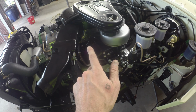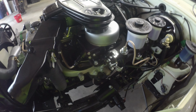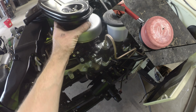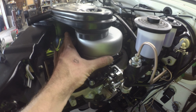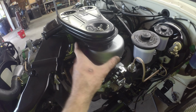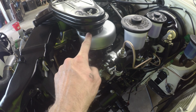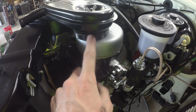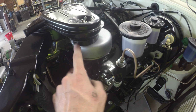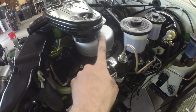This is my Holley Sniper cooking pot adapter. This was a cooking pot I got off of a thrift shop for $1.25. Cut it down, made a little adapter here, but otherwise pretty good to go from that 5-inch bore Sniper to the 3-inch bore air cleaner, and it's got kind of an offset rig. So that should work all right. Worst case, I may need to remake this adapter. I 3D printed it out of ABS. Worst case, can probably get one milled out of aluminum just to go with the aluminum pot. It is pretty sturdy, so we're sitting pretty good there.